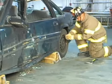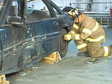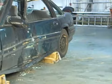See, rescuers, that went pretty quick. If you think about that, that might even be a little bit faster than normal step chocks and 4-point stabilization. As you can see, platform goes in, the wedge goes in over top, it gets tapped in a little bit, real solid. And in fact, if you deflate tires as well, you can insert the quick chock first, deflate the tire, and go from corner to corner to corner very rapidly. Simple, straightforward.